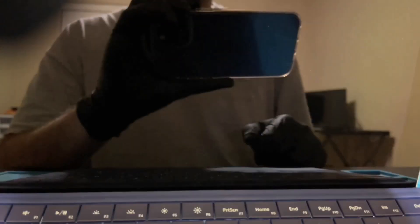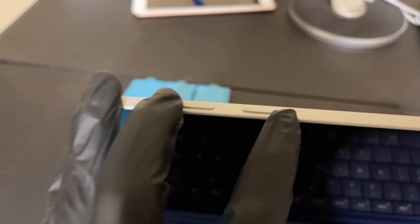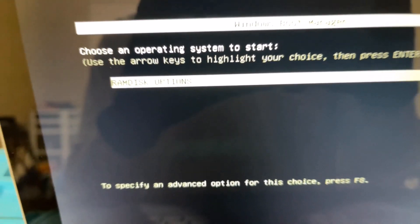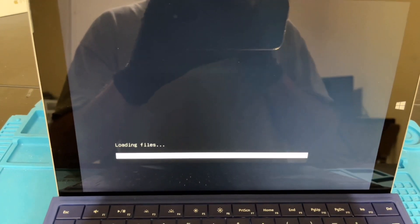The only difference is booting into the USB on a Surface 3. There are two buttons you're going to hold down. I have my USB already inserted. Hold down the Volume Down key — which is right here — and then the Power button on the left side, hold that for about two seconds. Release the Power button but hold on to the Volume Down key. You'll see the Surface logo on your screen and then it's going to boot into the USB. Once you see that screen, hit any key and it's going to start booting into the USB we created.